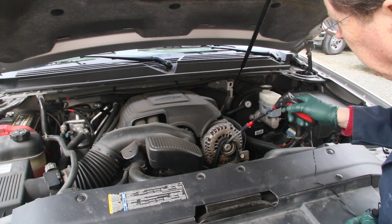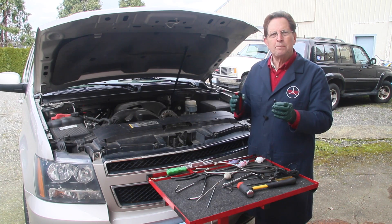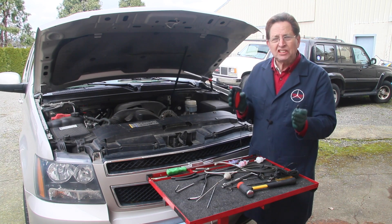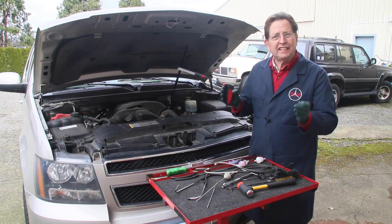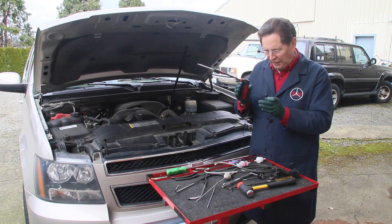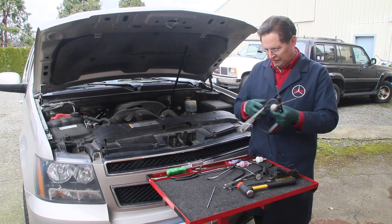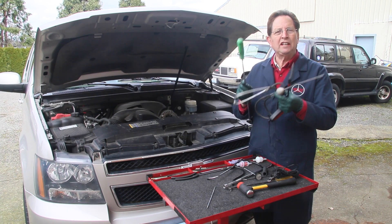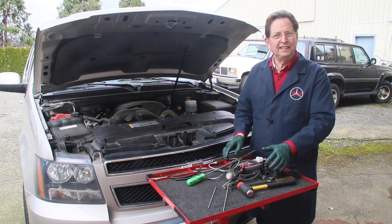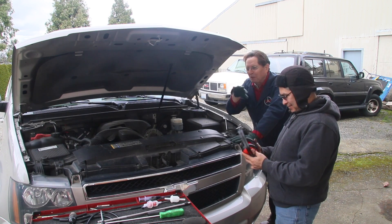So I brought in Jerson and said, okay, let's go to work. We're going to make something that can isolate noise by toning it down enough — isolate the engine noise, the extraneous outside noise, and tone the bearing noise down enough so we can differentiate between a good and a bad bearing. Because the screwdriver doesn't give you enough delineation between what is good and what is bad — they all sound noisy. After experimenting for over two hours with all the things I've shown you, we finally came up with what we believe is the ultimate design.